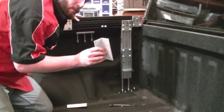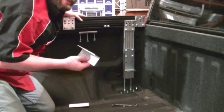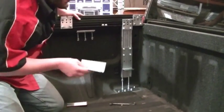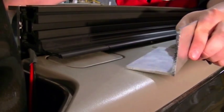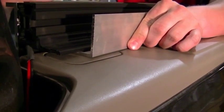We'll begin by taking a 1/2-inch wrench and lifting this leg extrusion up, making sure that it's getting jacked evenly. And for spacing, instead of using measuring tape, I like to use a 1/8 thick piece of material, such as this angle bracket, just as a measuring guide. You can pick up a 1/8 shim from the hardware store or something like that, and use it the same way. I've now adjusted the leg to the correct height, and as you can see with my 1/8 shim, it's at the exact right distance above the top of the bed rail.